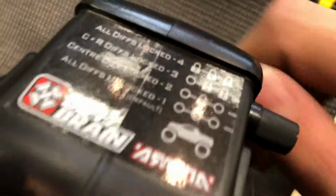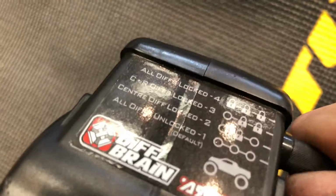My apologies. I think that's actually wheelie mode, but this third mode, which locks the rear 2 and unlocks the front one, actually helps with the rotational mass or momentum of the wheels. Because these 2 are locked and spinning at the same speed, and these 2 are unlocked and one's spinning a little bit less than the other potentially, it allows this thing to do crazy drifts and awesome stuff, which ironically does a better job at wheelie mode than the real wheelie mode does. It just lifts up if you go in a straight line, and as long as you're at a dead stop at first. I think the actual wheelie mode is better for wheelies.